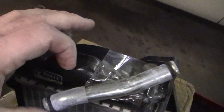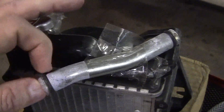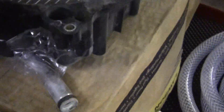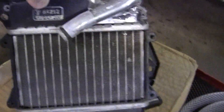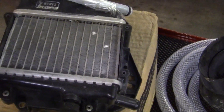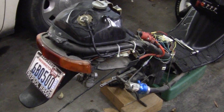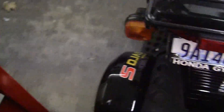They come in a kind of a weird design — they come with an upper tube which is removable that goes right here, and the lower tube is on the side. The way this works, and it's genius I have to say, is that on your motor, on your regular engine, you have a fan and a fan cover. What this does on the Ruckus is they don't put the radiator in the traditional spot.